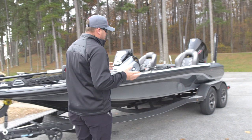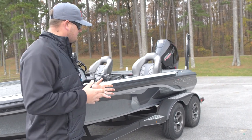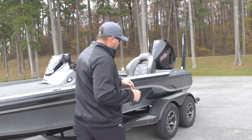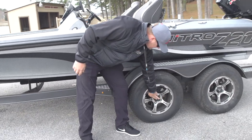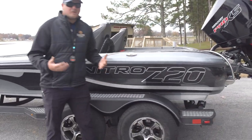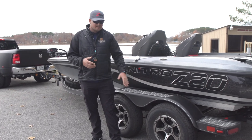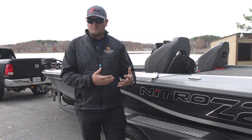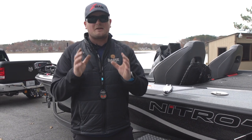The first thing I like to do at a gas station is check my hubs. I approach the tires and just go ahead and feel the hubs — which is the center of the tire — and feel for excessive heat. If they're extremely hot and you can't keep your hand on there for several seconds, then you might have some hub issues. You might have a bearing that went bad and some major issues that need to be addressed immediately.